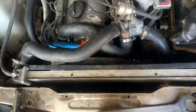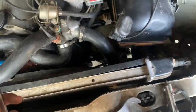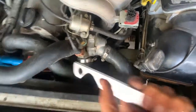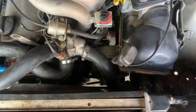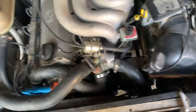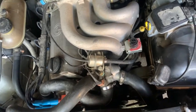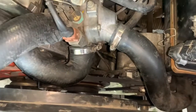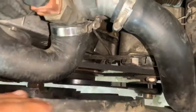To remove the fan clutch there are two options. Option one: use a fan clutch tool - the holes go over the water pump pulley bolts to hold the pulley stationary, then use a wrench - I think this is a 32 millimeter - to loosen the fan clutch. It's actually reverse threaded, so you have to turn it clockwise to loosen it.